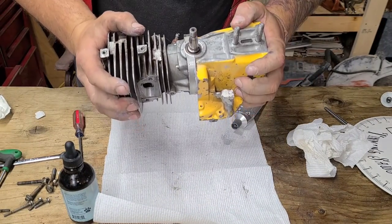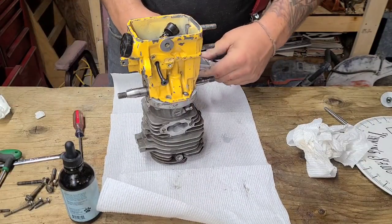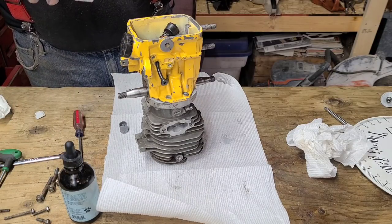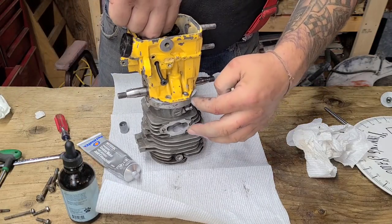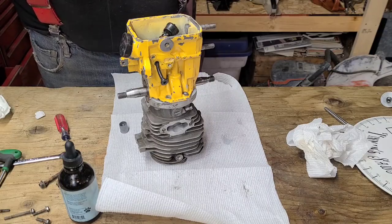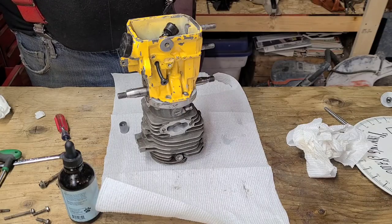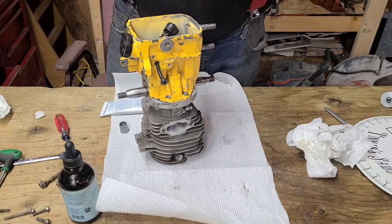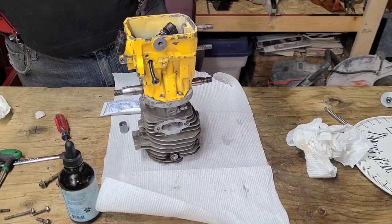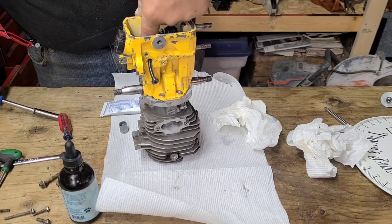These are fairly simple — the rings will start on their own and then you just chunk down and it goes. Notice there's a little bit of clearance when you put these saws together; it actually rocks slightly — that's normal, you're going to cinch that down and take it right out. That's why if you deck one of these, make sure you have all your bearing pocket measurements. If you go a couple thou too much off the flange, you could overload the bearings and blow your saw up in 15 minutes of running.